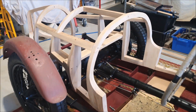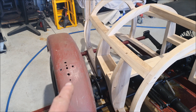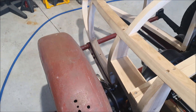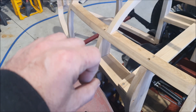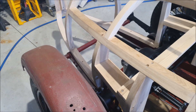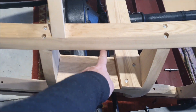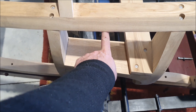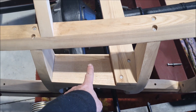The thing I'm looking at at the moment is the little clamps that hold the guards on. On a Brooklands, the way the guards are held in place is with three-quarter inch diameter tubing at the back, and there are three stays on each guard. There are effectively little tubes with a nut and a set screw that goes into them, and the guard stays go into that tube and it all gets clamped together.